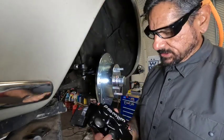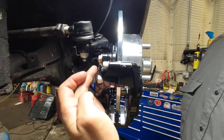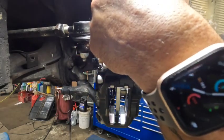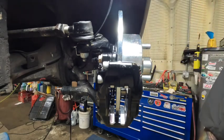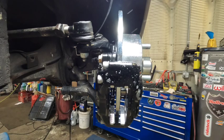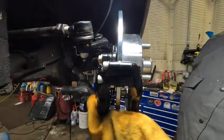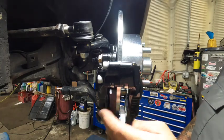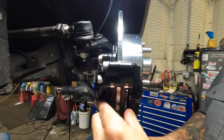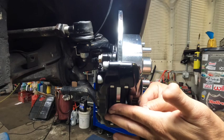Dry fit the caliper on first - everything looks like it's going to fit well. We put another washer behind the mounting hardware to make sure it stayed away from the rotor - I saw it coming past just a touch and didn't want any contact there. We're going to give this caliper a quick cleaning with some Simple Green and a microfiber. These Wilwood fronts are the best for doing the brake pad swap - nice and easy, just one cotter pin to hold everything in. So nice.